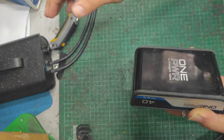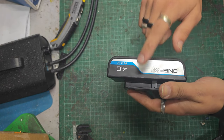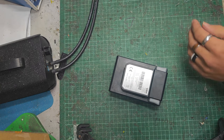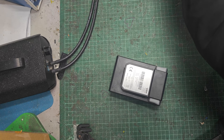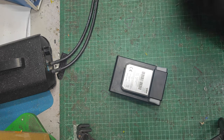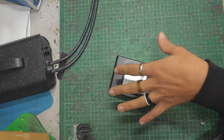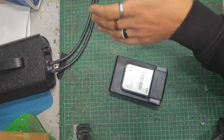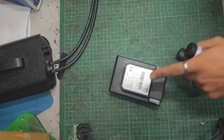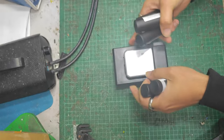And I had an issue the other day where it just wouldn't charge. I thought, oh, fix it then, shall I? Basically, I'm pretty sure inside this are 5 21700 cells that I'll be able to just replace. I don't know if disconnecting power from the BMS inside it is going to turn it off or not. So what I was going to do was hook up my benchtop power supply at 18 volts or so to keep the BMS powered up via these pins in here. I'll find out what they are.